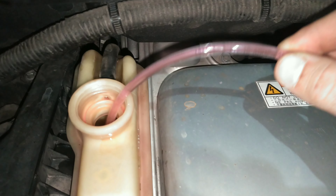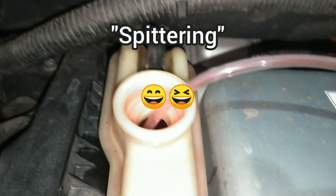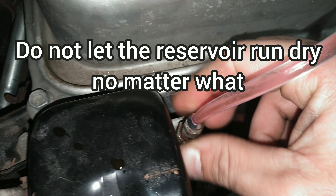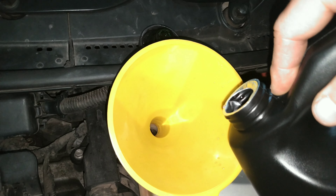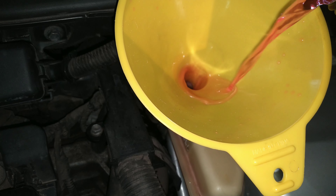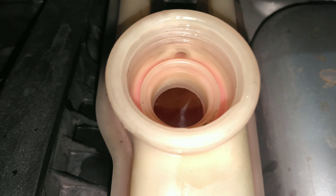You want to do this until the tube stops having those air bubbles and has a nice even flow. As you can see, the coolant has gone down a little bit, so tighten the valve to stop the flow, take the tube out, and put more coolant in. You want to bring it back up to almost the full line on the reservoir, because the coolant is flowing through the system very rapidly.